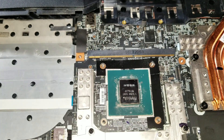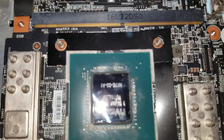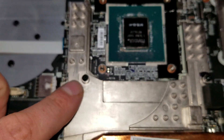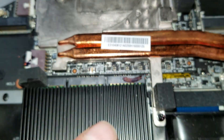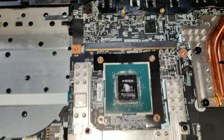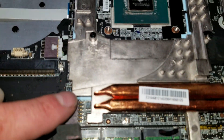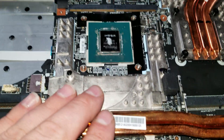And when you're done, your GPU should look nice and relatively shiny, kind of like this guy is. I'll be right back with replacing this thermal paste. So here we are, we're back. There's my little pea-sized thermal paste. As you can see, I have new thermal pads - there are all the blue ones.